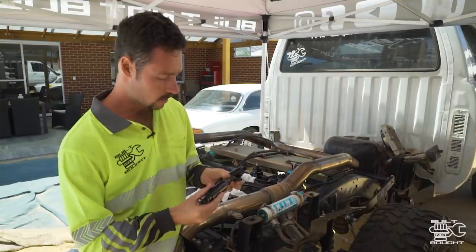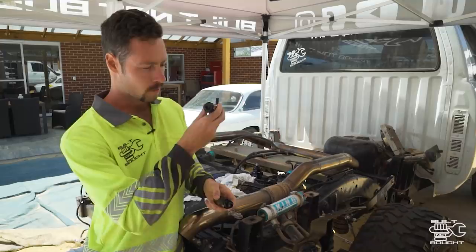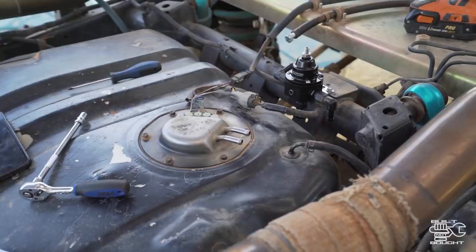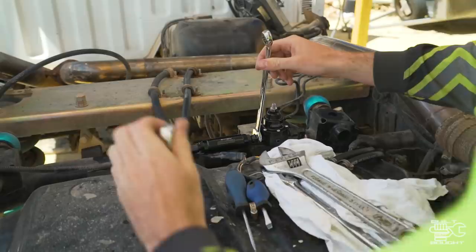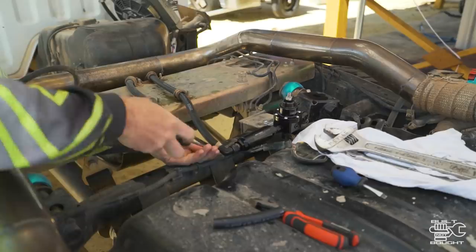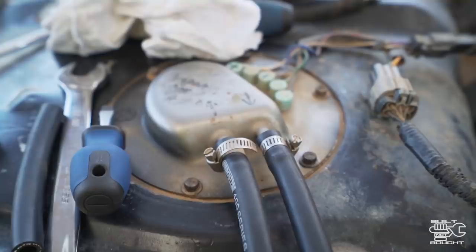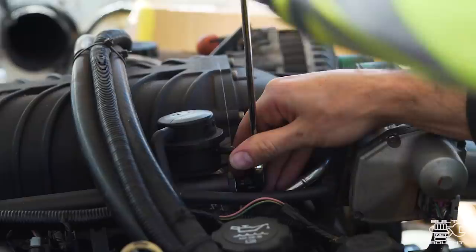Before I had the regulator that was a filter in itself, and then I ran a 40-micron filter up near the fuel rail. I'm going to upgrade all that — I've got a 60-micron near this regulator, and then I'm going to upgrade the one near the rail to a 10-micron, so it's even finer to really filter the fuel. There's also a strainer on the bottom of the pump to catch all the big chunks in the tank, then it runs through the 60-micron, then up to the 10-micron. I'll have one basically on the back side of the regulator bolted straight in, and then the hose off the end of that goes up to the fuel rail.